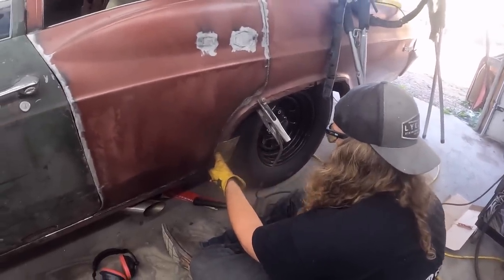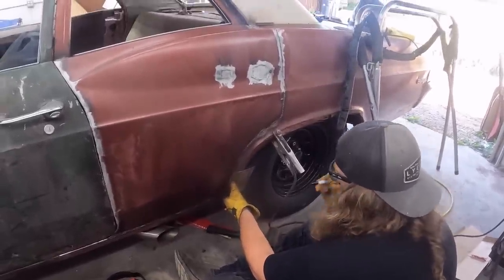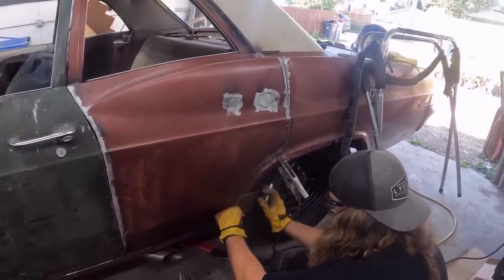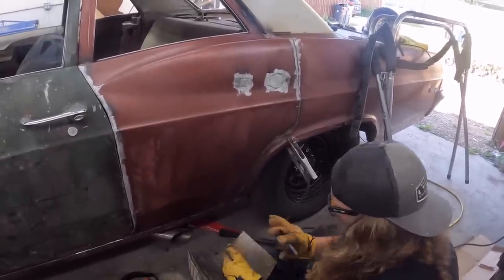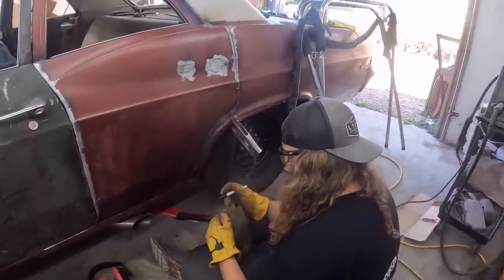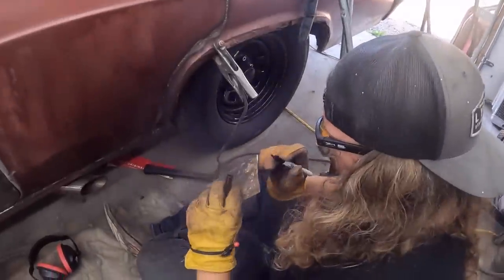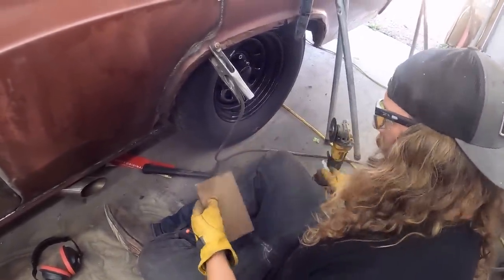Well, that's not bad. So then if I do right here, there and there, that'll be a 90. So that's gotta fold that way. Mark the back in case that's the way it wants to be on the brake. Now it's definitely not going to be perfect. I know that's shocking, but let's see, it's a pretty good idea.